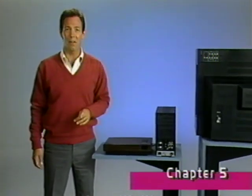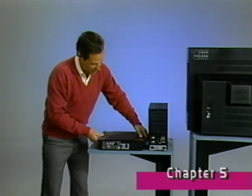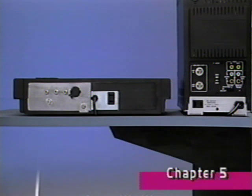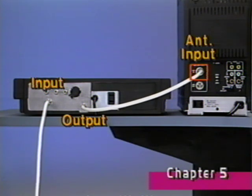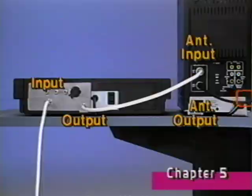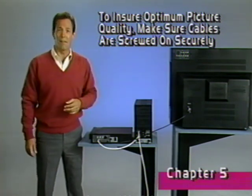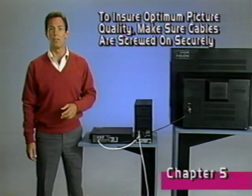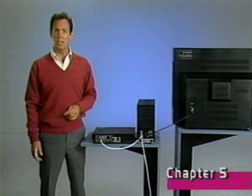However, many cable TV systems use a special cable box to protect their signals. This complicates the hookup situation a little, but there are several options you can select to suit your particular recording needs. Here's one example of how to hook up a cable box to your VCR: the cable signal coming into your home is first fed into the input jack of the cable box, then fed out the output jack of the cable box and into the antenna input jack on the VCR. Then the VCR output signal is fed to your TV. The advantage to this hookup option is you can record all available cable TV channels, including pay or premium channels, because you're using the tuner in the cable box to make channel selections. The disadvantage is you can't use your VCR to make channel selections.